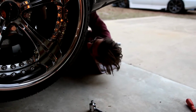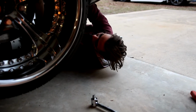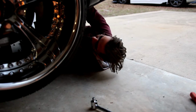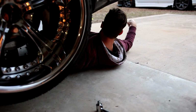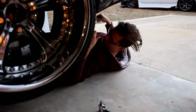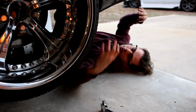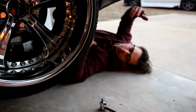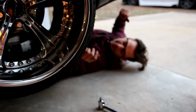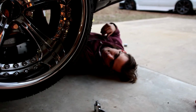All right. So what does this rear brace do? So basically, JZXs have this awesome ability to crack subframes, and this reduces the stress on the actual subframe by displacing each high stress point to the bars. So it reduces the chance of cracking subframes, which I'm sure mine's already cracked. I just don't want to pull it and find out. But this should help in theory if it is.